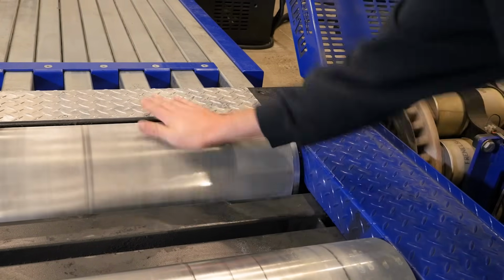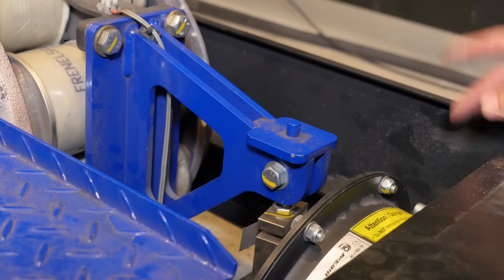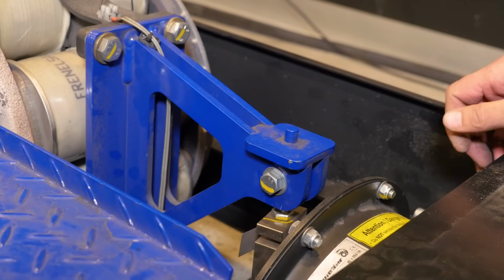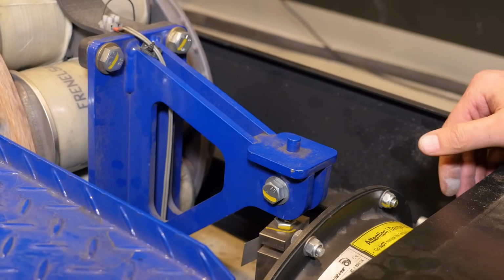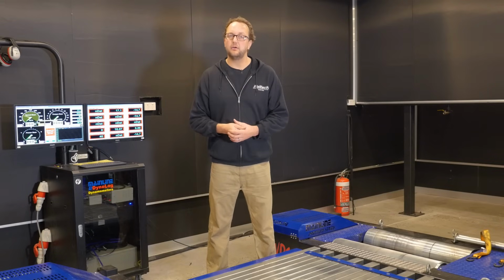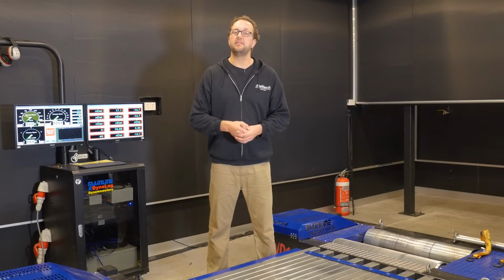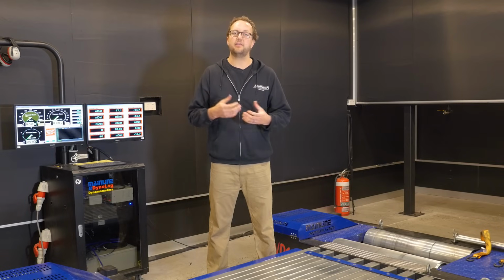It needs to control the rate at which the retarder shaft spins, and it needs to measure the load at the retarder arm from a load cell found mounted between the retarder and the dyno chassis. Notice this mechanical connection's the only thing stopping the retarder from pivoting forward, and the only thing that's measuring how hard the retarder is being forced against the dyno chassis. In order to control the rate of acceleration of the roller, or to hold a particular roller speed, there is an eddy current retarder attached to the end of the common shaft that the car's sitting on.